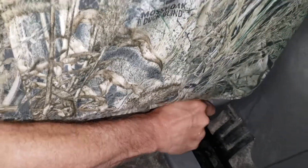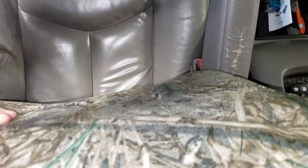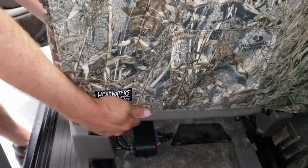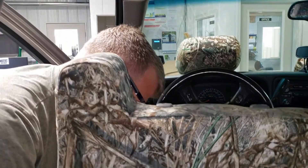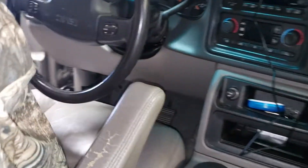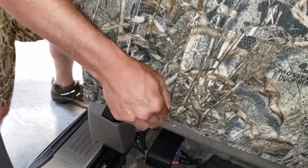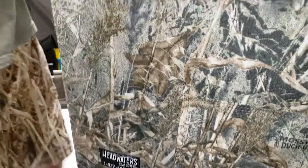It should be pretty close to touching. Slide your hand down and touch it in. If there's a slight amount of wrinkling, detach the velcro, go back to the front, and sweep your hand down to get those wrinkles out. Hold that tight, press it against the seat, come to the back side, hold tight, press down, and reconnect. Now the material is touching — you've gained about an inch. The backrest section is done.